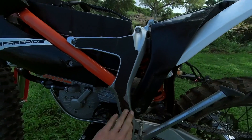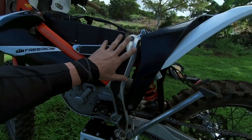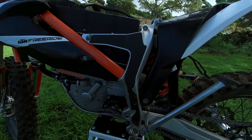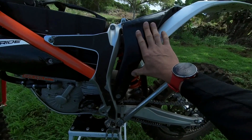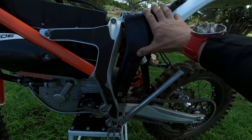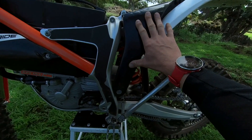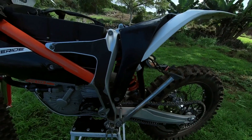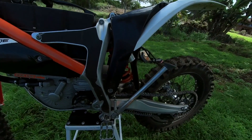I'm not seeing any problems with the frame yet — it's a neat design. The frame pieces are obviously separate and different colors. I'm probably going to take them off and get them powder coated as part of a facelift on this bike. The subframe is plastic, a bit like Husqvarna's motocross and enduro bikes. I've flipped and crashed this bike several times and the subframe hasn't broken. These have been on Freerides for years, which is probably why KTM knew they could use plastic subframes on the Husqvarnas. It's not the strongest thing, but I also don't think it's the most expensive.